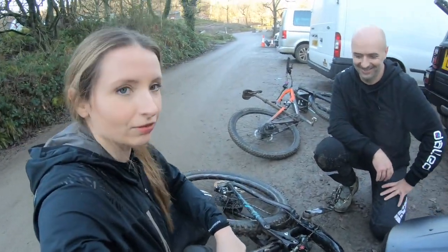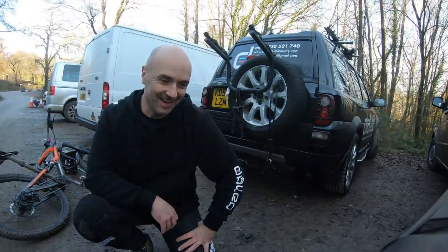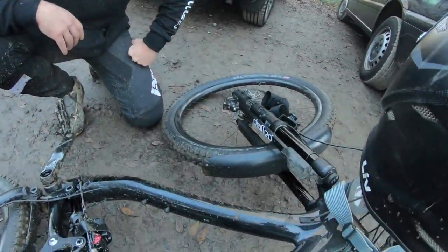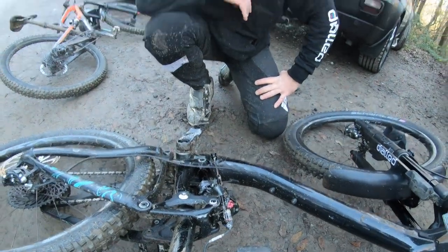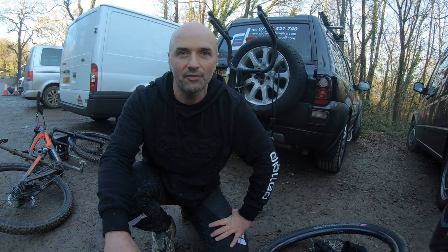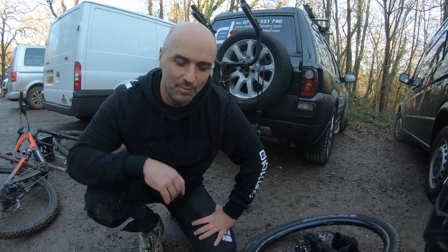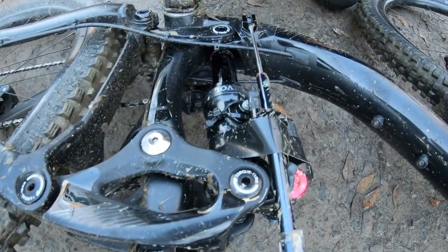Just done our first run. Dave, do you want to say a bit about what's going on with my bike? First run done. We're mostly looking at the average axle position — sort of like a dynamic sag measurement. What we've got on Alyssa's bike is the fork's not sitting too bad, but the rear's sitting way deeper into the travel than the fork. It's also evident straight away that her rebound speed on the rear is way slower than the front — a lot slower. We're not going to change anything on the rebound settings because we're going to add a load of air into this shock, and the extra air pressure is going to probably speed up the rebound anyway. So we're going to get some air in there and go for another run.